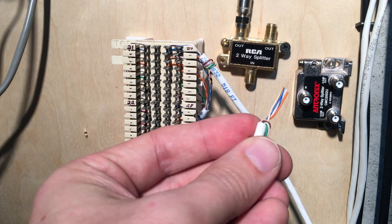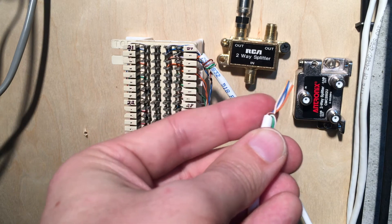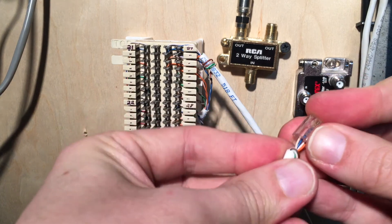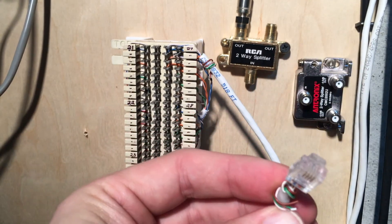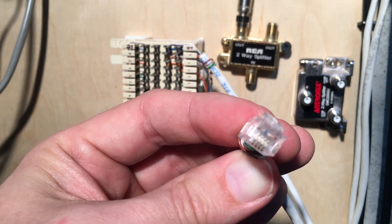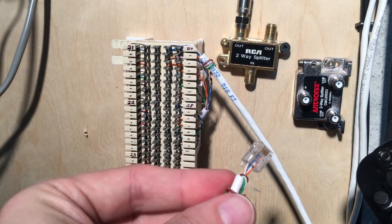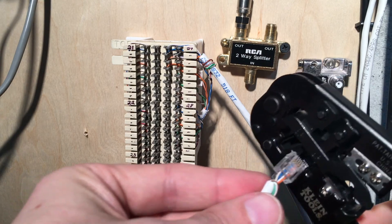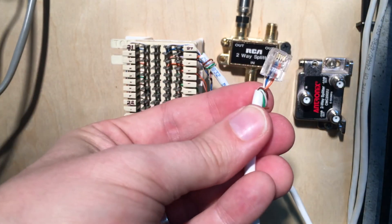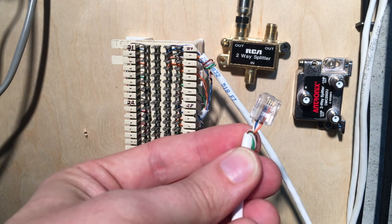You want it to look something like that so it goes white-orange, blue-white, white-blue, orange-white. Go ahead and jam the RJ11 plug in there, and I always look at the front to see if the wires are all making it to the edge — I really want to make sure that's nice and tight. Grab your crimp tool, put it in the right side for the RJ11, and squeeze it down, and now you're done. You can plug this end into the Panasonic phone system using the EasyCord adapter cables.